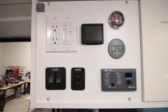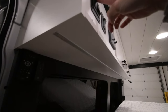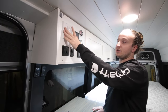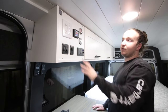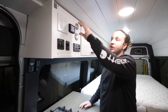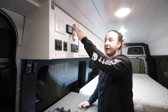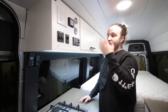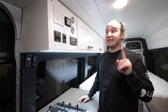Overhead, we have the brains of the system. We have their water pump here — we are currently winterizing this for them and putting it away in storage. You have two lights: the under-cabinet flush-mounted lights and the pot lights for the whole vehicle. You also have an outlet and your hot water timer — their hot water is on a timer, they have hot water in the rig. There's the upgraded remote for their diesel heater; you can set timers and different monitors, running the temperature from here. There's also the fresh water gauge, their Victron battery monitor to monitor all levels, and the multi-control for their inverter which handles the shore power and 110-volt in this vehicle.